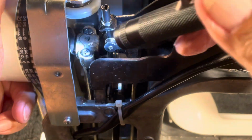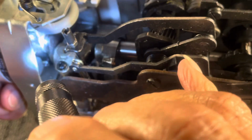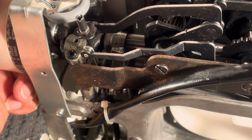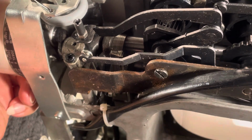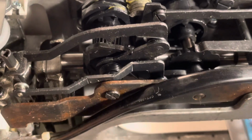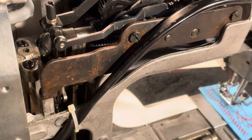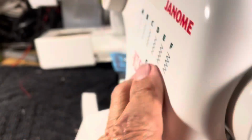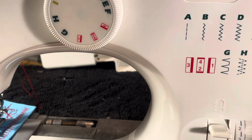But you take the little ball bearing, that's the bearing over there, shine the light back there on it if I can get it back in there, and you take the little cap screws that hold it on top, you loosen those, and you get the ball bearing sliding back and forth, and you take your penetrating oil and regular oil and you force it down in there and work it. And if a machine is bound up and going real slow, you don't want to tax the motor by making it work too hard. You'll burn the motor up.